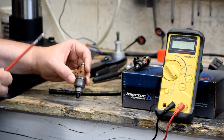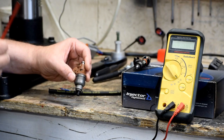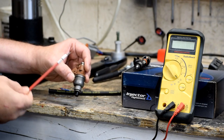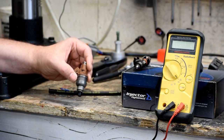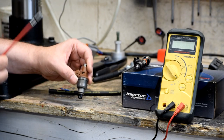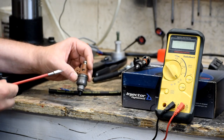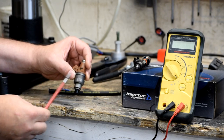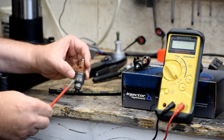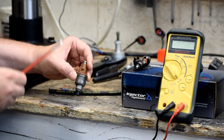For some of the Mitsubishi cars, some of the Toyota cars — performance cars in the 90s — they wanted to use high impedance circuitry because it's cheaper. The circuit inside the computer is much simpler: just turn everything on, turn everything off. The extra circuitry for peak and hold adds cost, as do the injectors themselves. But they found that with high performance, low displacement turbo cars — the Mitsubishi Eclipse, the Evo, the Toyota Supra, the 3000 GT and the Stealth — they couldn't get the performance they wanted out of high impedance injectors. So what they did was use a low impedance injector's higher performance mechanical bits with a high impedance circuit, getting enough extra performance from the extra windings and lighter pintle to deliver the fuel they wanted while retaining simple circuitry in the computer.